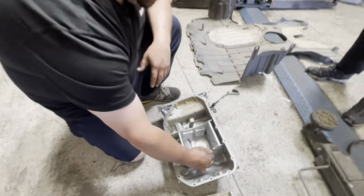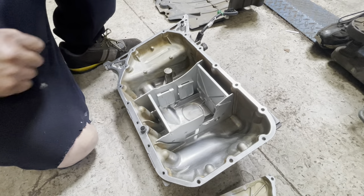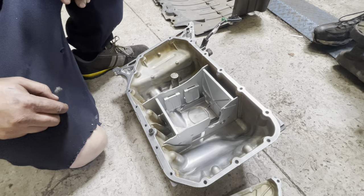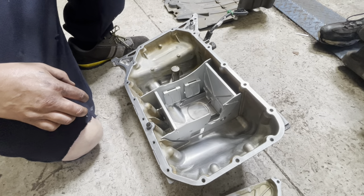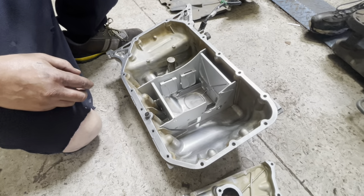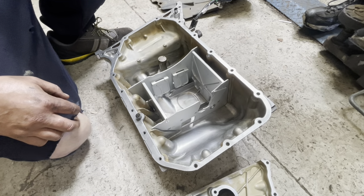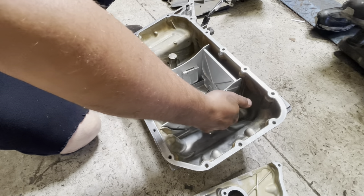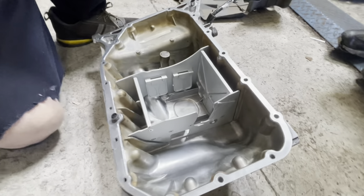Okay Rich, so that's definitely the sump. It is. And that just drops in there — yeah it's just a drop-in baffle. It's got little windows on it. And that's to stop the oil splashing around in the bottom? Yeah, it's to keep oil around the pickup point. So on a long sweeping bend you don't lose the oil across the pan and then obviously have oil starvation. Obviously we've cleaned the sump up, cleaned it out, cleaned up the mating surface — everything needs sealing. That's how it sits in there, and when we lift the sump up into position the pickup pipe will push down on that piece and spin it round so it obviously doesn't fall off.